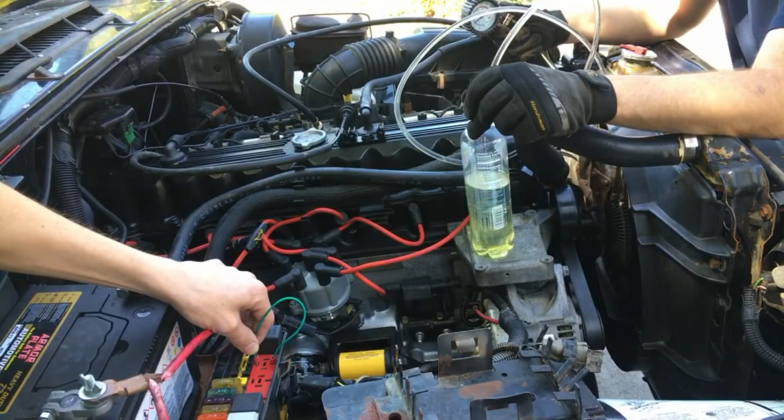So we left that day thinking, all right, we've got to double check the timing because we're not 100% sure. Well, we also flow tested it. Oh, we did the flow test, true. Yeah, we got 500 milliliters of fuel through in 30 seconds. The flow test was perfect, right where it needs to be. So good flow, good pressure. So we're thinking fuel is good. But it could have been the injectors. We were still suspicious of the injectors.